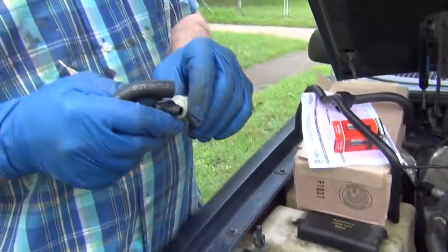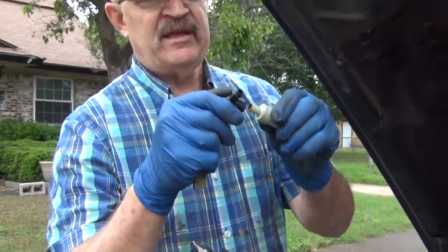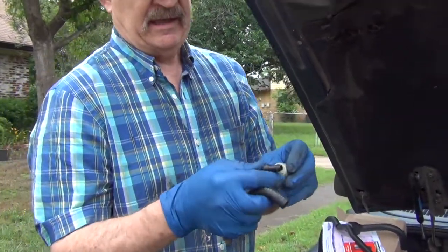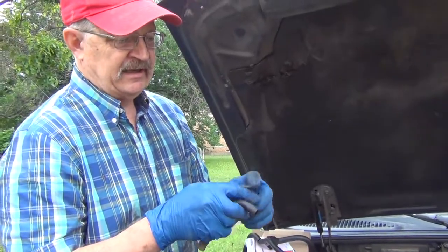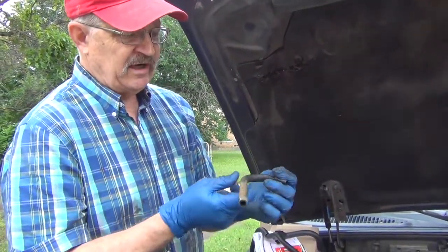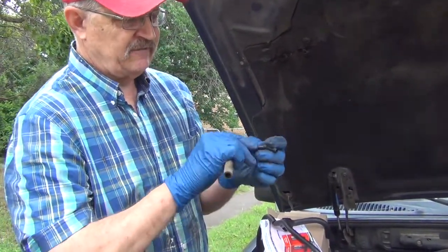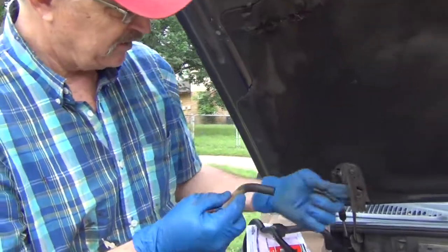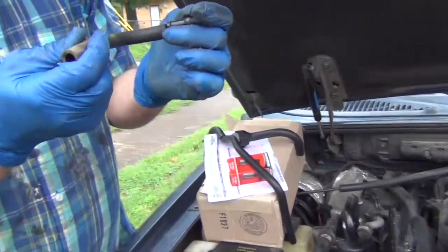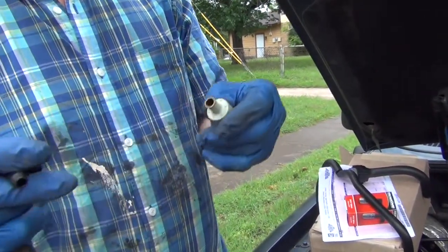So I thought I got this out, I pulled this out. If you put it in some hot water, you can pull this loose. Now the problem was, getting these hoses off was very, very difficult. So I don't recommend taking these hoses off — take them off over here on the manifold on each side. Leave all that on there, take this off, and you can take this loose.